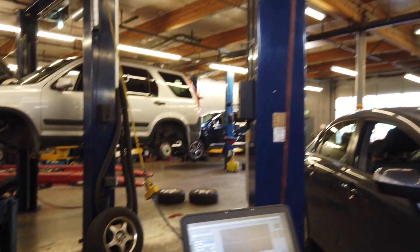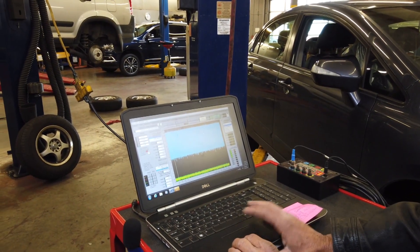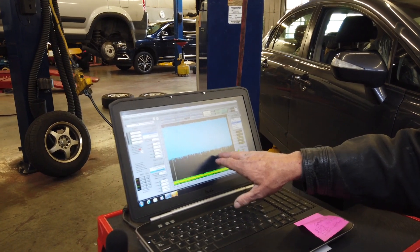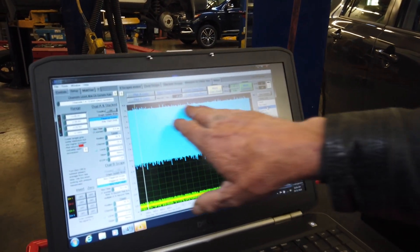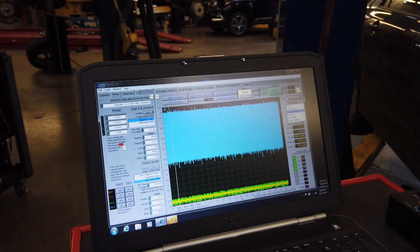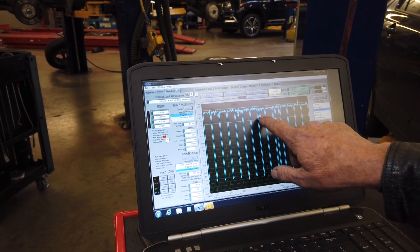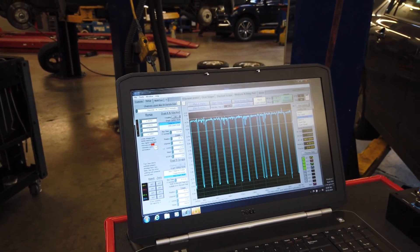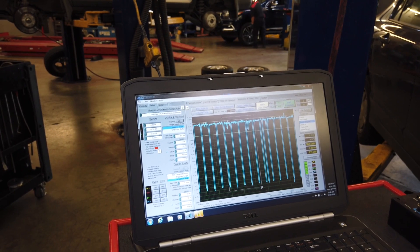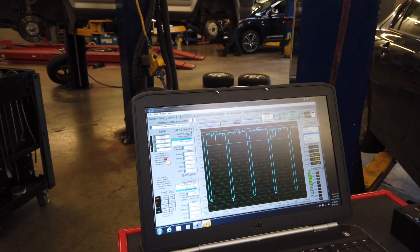What we're going to do is come over to our measure and deep record screen and start a record. Immediately we can see that we've got a lot of voltage hash and activity below the ground line and above it — so this sensor is kind of glitching out right at the moment. If we zoom in more tightly we can see that the sensor is having a hard time keeping its voltage at the top as it goes through the windows and switching in the hall effect.